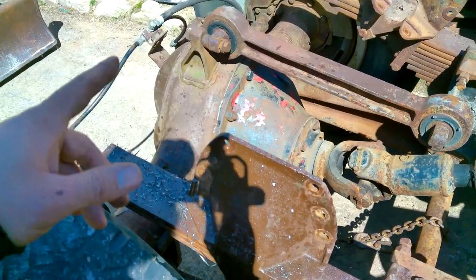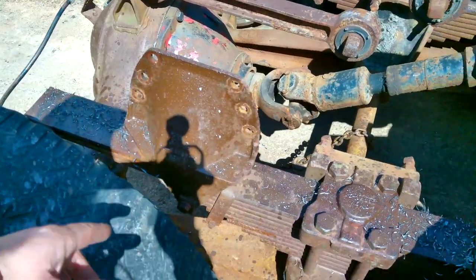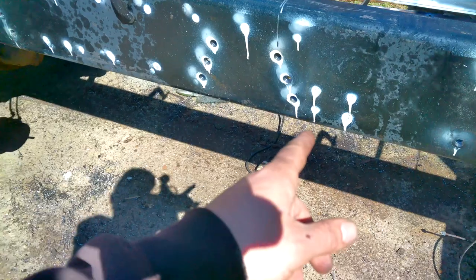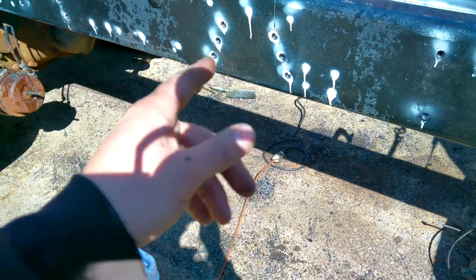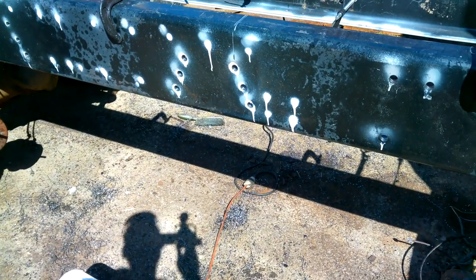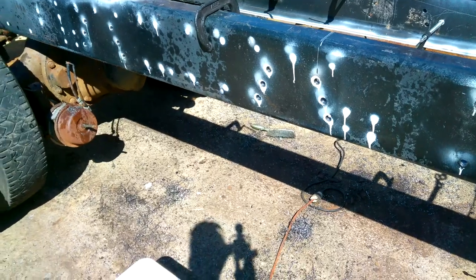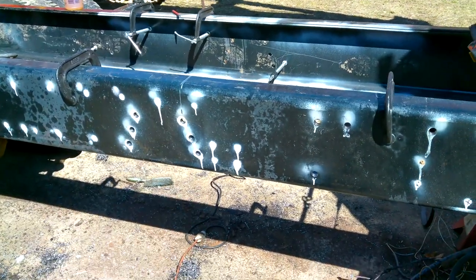So I ordered two of them because the other ones were cobbled together and the axle stops were homemade. Well, I ordered new ones with inner axle stops, and I'm still working on the front axle stops. I didn't drill those holes, so I'm waiting. I got a part number off an International for some stops that are factory made. They look good. I gotta get some prices on them. They're probably not too much. They gotta be cheaper than those extended leaf spring hangers. They were only $80 a piece, so I'm sure these are cheaper yet.